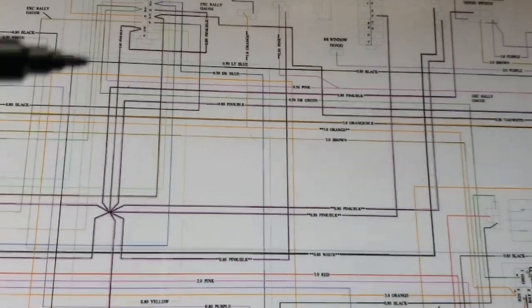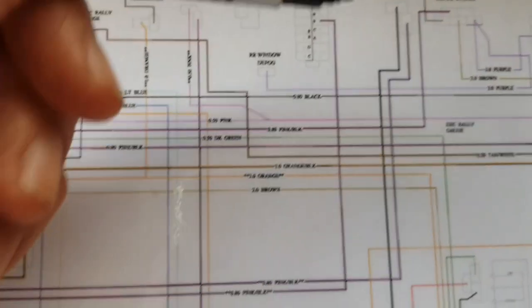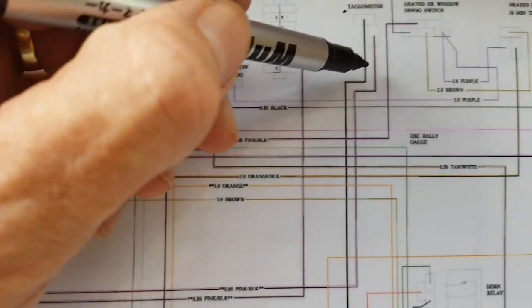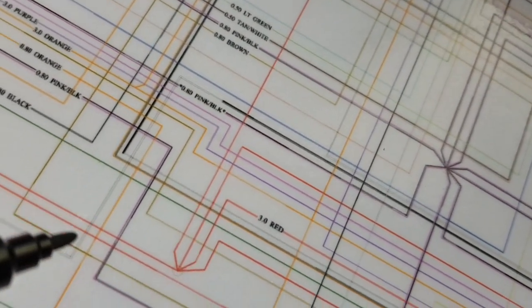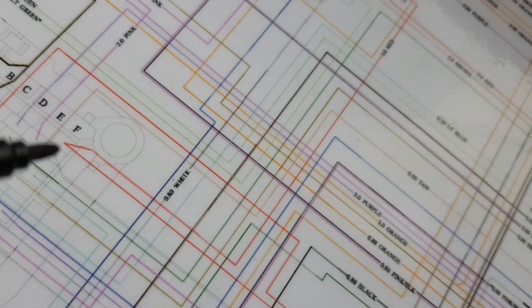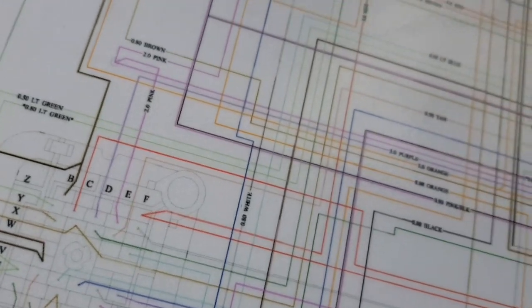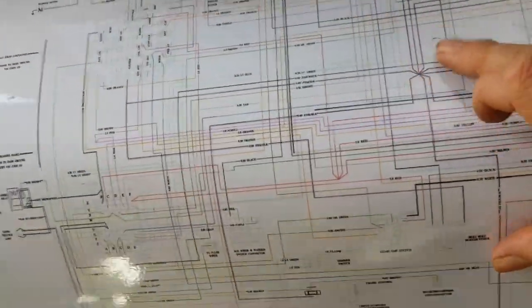Now let's work out which particular wire we're going to use for our tach. If we look at our wiring diagram here — it's a great thing to print up — you'll notice just here there is our tach. You've got your positive and this black wire on the diagram, which if you trace it across is actually white. We track it all the way across through a little maze and it actually comes out in the firewall and from there connects to your distributor on the 1980 Trans Am. If you can find your diagram online, you can draw on them and laminate them and just wipe your stuff back off — it makes working on these cars just that little bit easier.